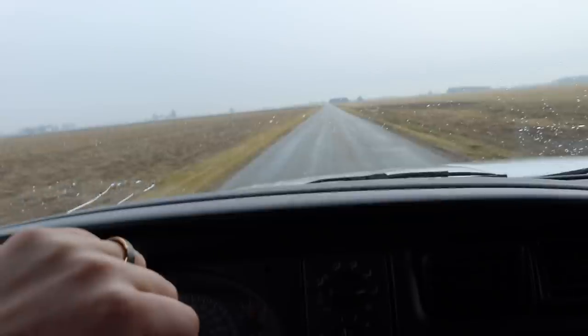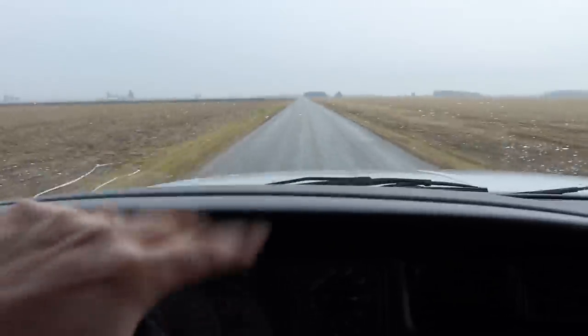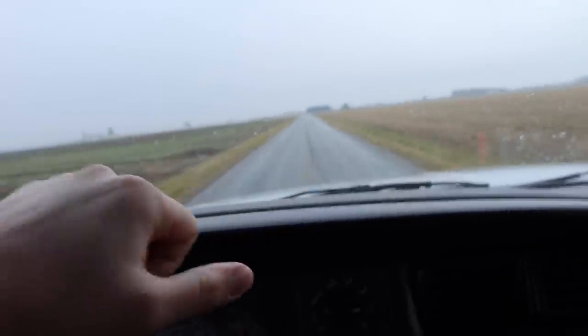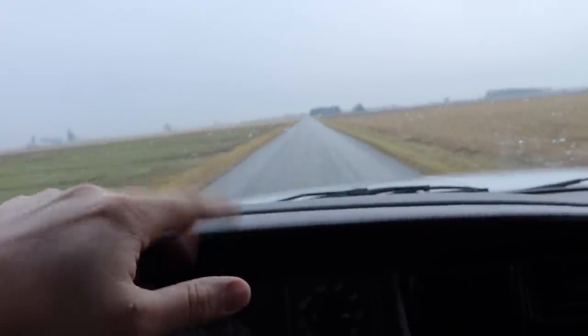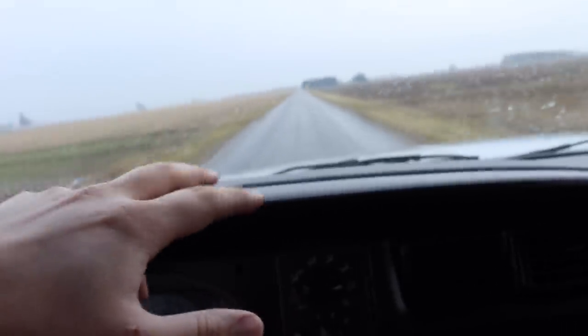They're like, can't wait to see you in here. To me, that just goes a long ways. All the really big commercialized shops and stores don't really do that kind of thing anymore, but that's what makes me enjoy these little small town hardware stores so much. I got to say, I really like driving this truck. I used to kind of hate on 24 valves a little bit - the VP44s kind of suck, you couldn't get a 53 block, and they're not going to run as long without issues. The injectors are more expensive, the fuel systems are more expensive. But if you have a good fuel system on the truck and a good lift pump and you drive the thing and take care of it and maintain it, I can definitely see why there's a lot of guys that would really like driving these things. They're comfortable.